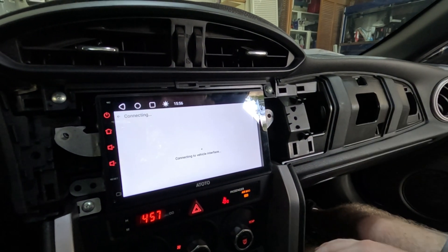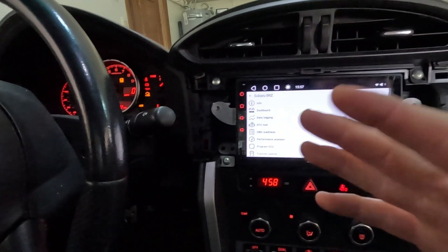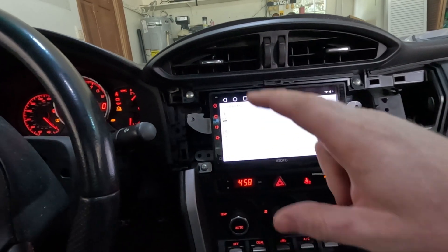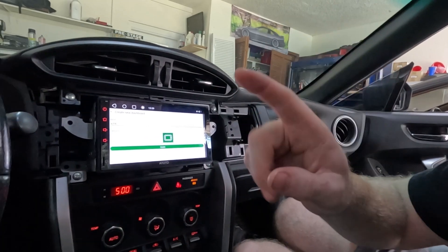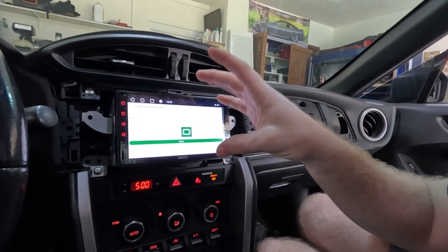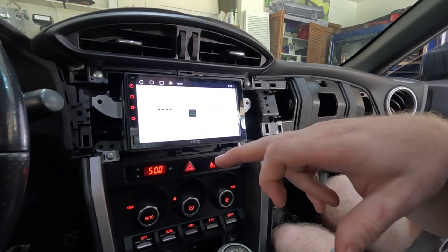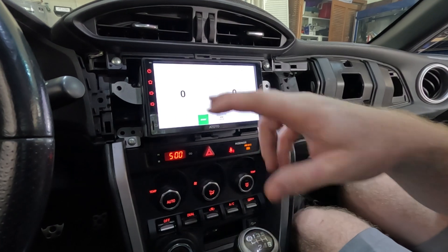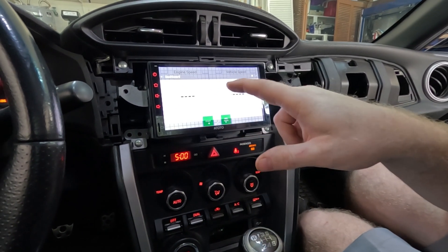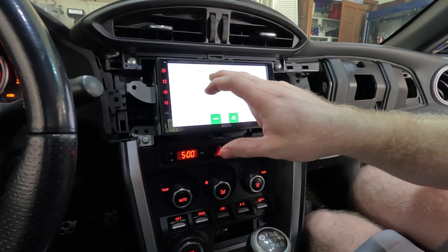With this I'll be able to actively see any kind of engine parameters that my ECU tech dongle will recognize. I got it connected — there's a little bit of a process but we've got it figured out. Click on Dashboard. Every single dashboard is going to be different for ECU tech. Hit the plus button in the top right, create a new dashboard, select portrait or landscape mode, hit create, and you can add new parameters. Now I have engine speed and vehicle speed — let me edit these so they're not so big, and move them around to add more gauges.